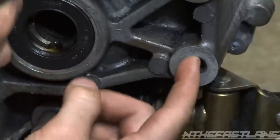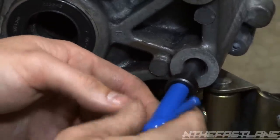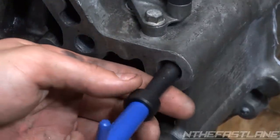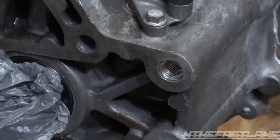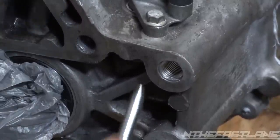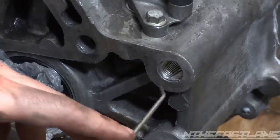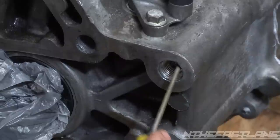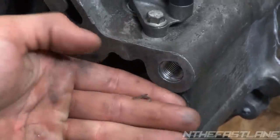I'm going to go a little bit more because the top is still sticking up a bit. I just finished tapping the second one. When you're at the end, get your punch and just tap it — it breaks off that piece. That's pretty much what it is. If you don't have a punch, a lot of people just stick an extension in there and break it off, then put a little pick in there and pull it out.